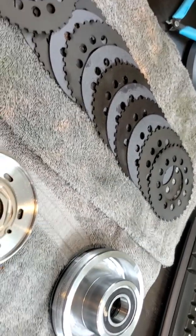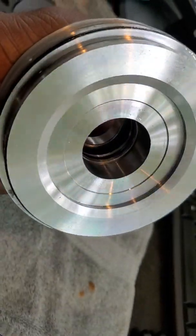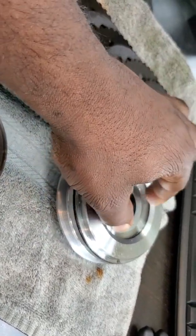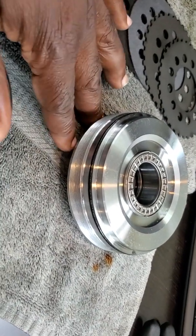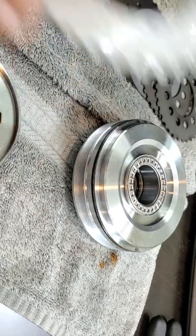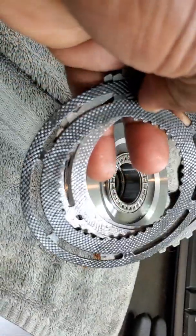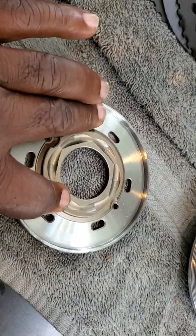Your electromagnet will sit inside here and it spins along the base of your carrier. The inside assembly has a couple of cutouts on the inside — those cutouts are actually for your washer, which sits inside like so, and your flat bearing. As electromagnetic energy is passed through, it will pass through the lid and pull your ramp pressure plate. Everything in between the ramp pressure plate is sandwiched to the bottom of the lid. When that happens, this rubberized-coated clutch is actually responsible for turning the ramp cam and applying pressure to the pressure plate through your ball bearings.